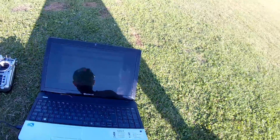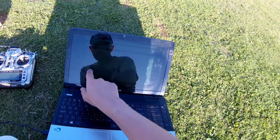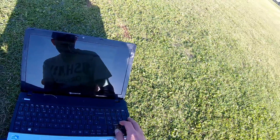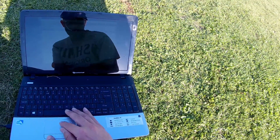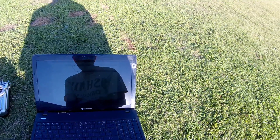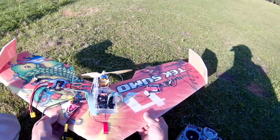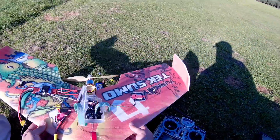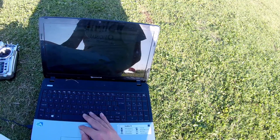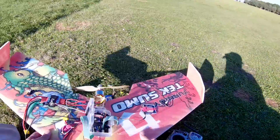On the flying side I got the laptop out and did what I thought was right — what I'd do with a quadcopter, which was just turn the gains down a touch. What I've worked out since coming home and producing this video is that I should have basically divided the gains by two. Whatever the P gain etc. — whatever the values were, I should have halved them. A later flight confirmed that did seem to do the trick. The TechSumo is still fluttering wildly, but we're going to chuck it in the air anyway and see what it does even with a slight decrease in settings.